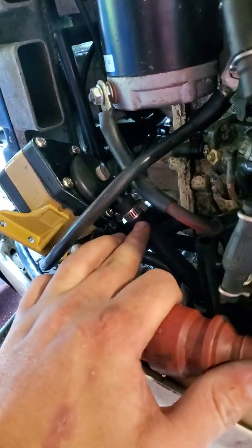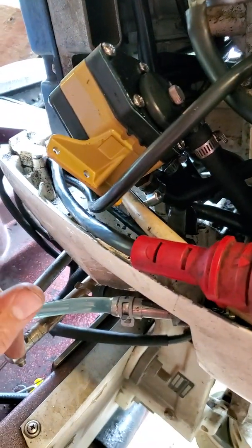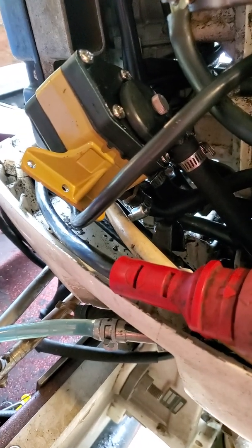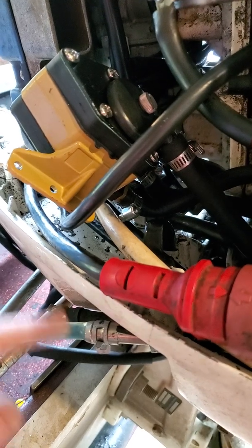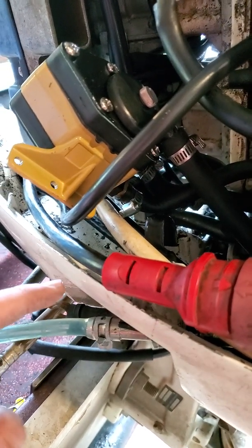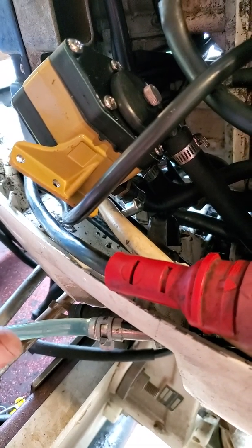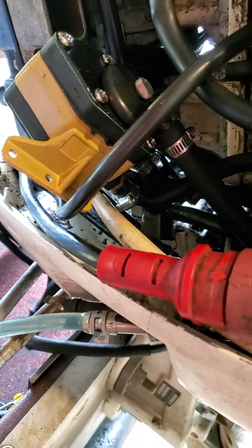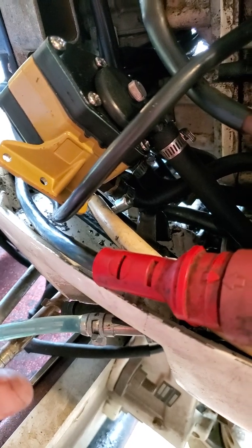It has a pre-installed hose that basically goes from one side to the other of the fuel pump. I don't know exactly how these things work, but I know it works off the pulse of the engine. This is not a VRO fuel pump — it replaces that, so you'll have to pre-mix your fuel, because you're not hooking it back up to your VRO. From what I understand, I don't think you can.